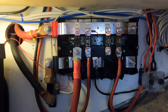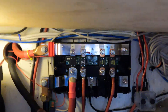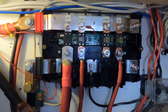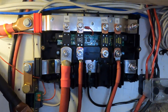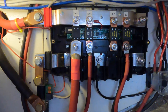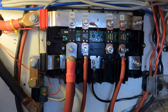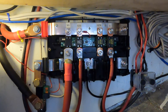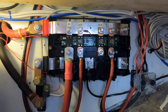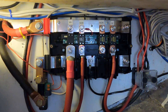This unit is called the Lynx Distributor from Victron. It's basically a big, fancy, expensive bus bar. You have individual fuses for everything plugged into it, and it basically powers your whole system — with the added benefit of being both a fuse bar and a bus bar. It was very expensive, but if you add up the cost of buying all the mega fuse holders and connections separately, you actually save money buying this if you're going with quality parts throughout.